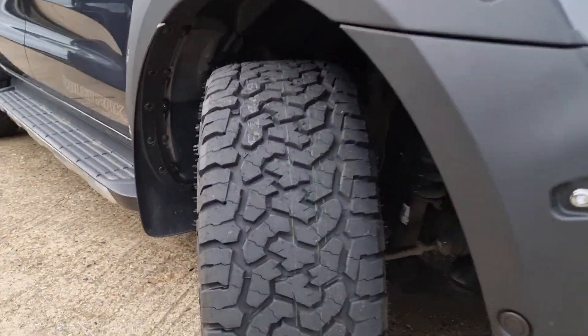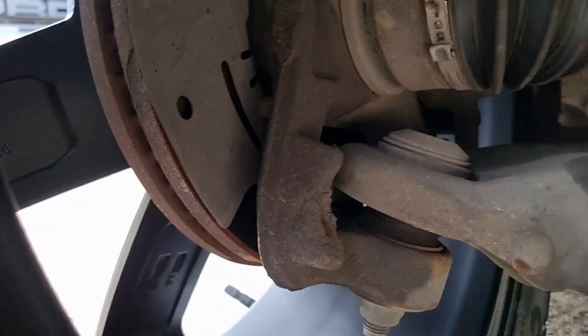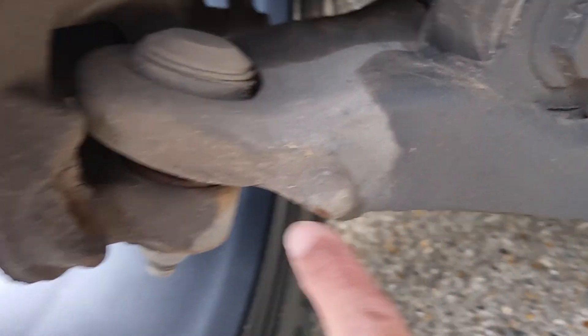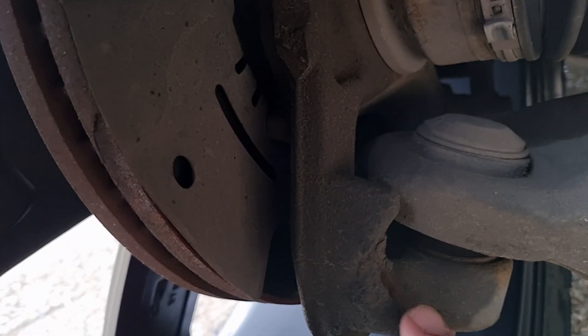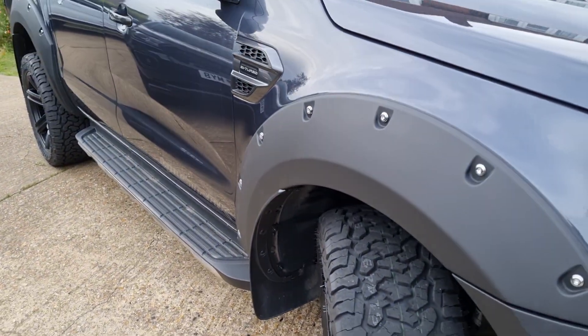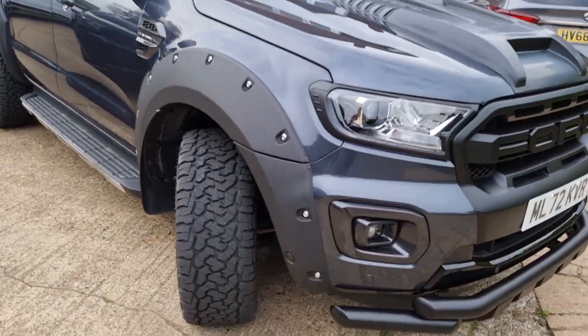It's a design feature to stop the wheel from almost tearing itself off the axle if you're doing heavy off-roading. There's one on the rear of the axle and one on the front — this one's a bit easier to see. That then goes into that when the wheel's turned fully the other way, making that metal-on-metal clunking sound if you go over a kerb on full lock.